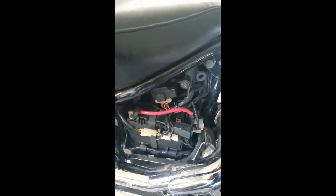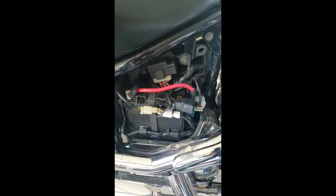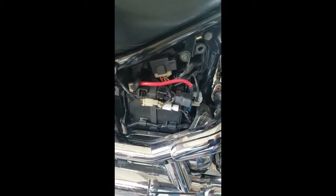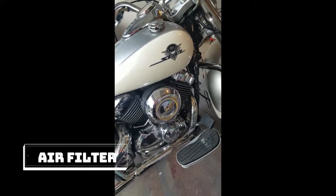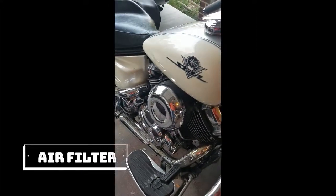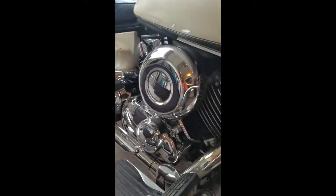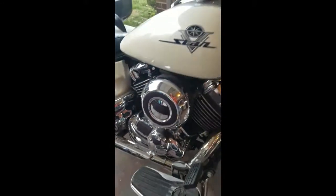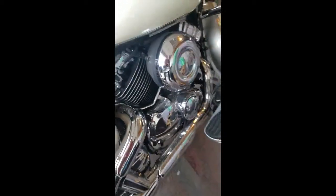And there's your battery — positive post, negative post. You can either jump it from another vehicle or put it on a battery maintainer and let it charge for a couple of days to get it going again. Now, we know that there are two things that a gasoline engine needs, and that's fuel and air, both to work properly. Before messing with the fuel, you probably want to look at the air because it's a little bit easier to deal with.